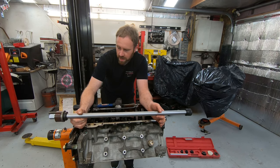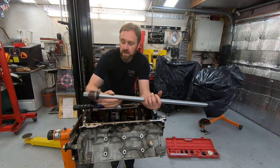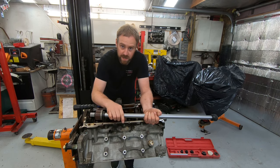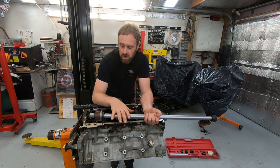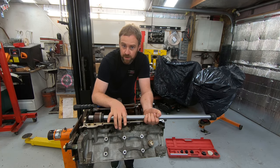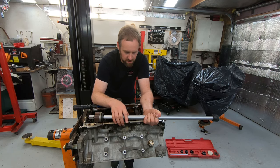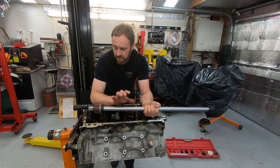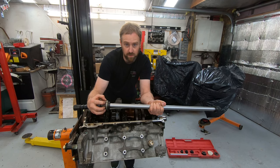This tool is a cam bearing installer/remover tool specifically designed for camshaft bearings. It has different pellets on the ends that fit different sized bearings for different engines. I'll throw a link in the description for this tool — it's very nice to have if you're doing enough engine work, otherwise you might try to rent one, possibly at an O'Reilly's. You need to find the collar that is the right size to loosely fit in the bearing, but not too loose.